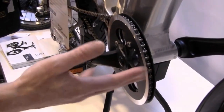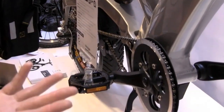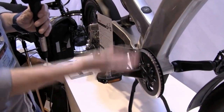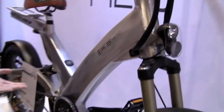It makes sure to keep it cool in high-pressure situations, whether it be a heavy rider, riding uphill, hot day, what have you. The other nice thing about it is we now have the ability to actually custom-program software, drop the controller in and out, and put that software onto the bike fairly quickly and fairly easily. With this controller and all the components, they all speak to each other using the CAN bus protocol.